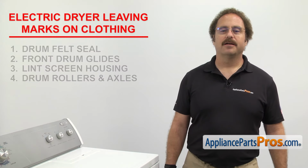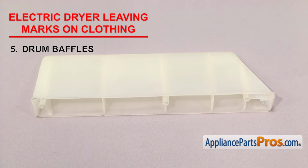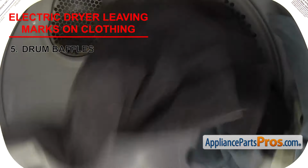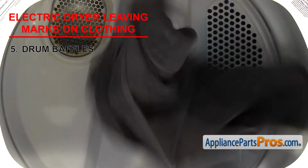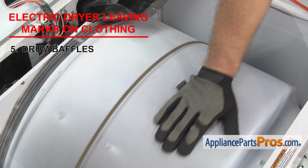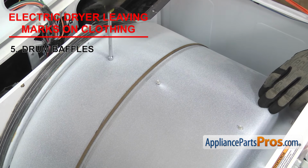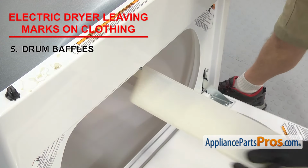The last thing to check are the drum baffles. There are usually 3 of them mounted inside the drum. They help tumble the clothes while the dryer is running. If your clothes are getting marks on them, it could be that the screws have loosened and the clothes are getting caught between the drum and the loose baffle. If that's the case, you'll just have to lift the top up and tighten the screws. But if any of the baffles are damaged, you'll have to replace them.